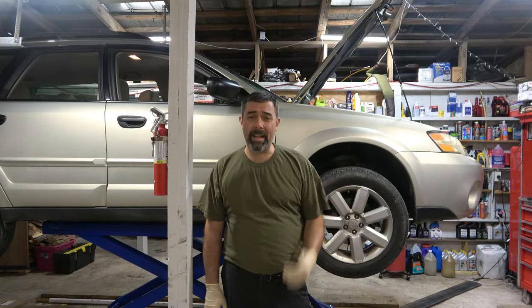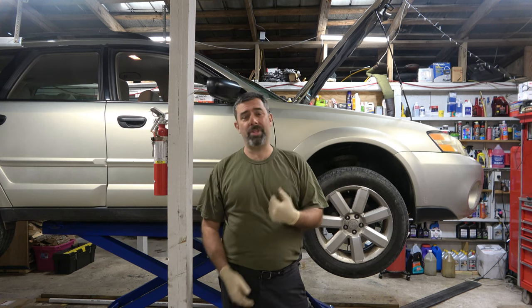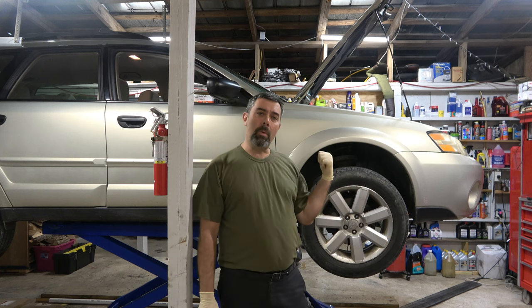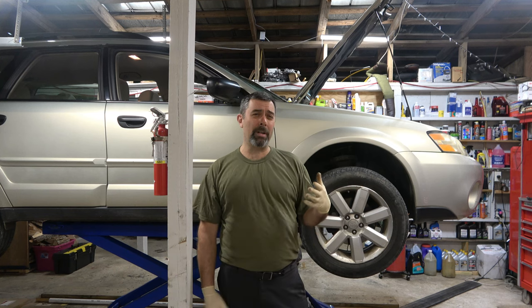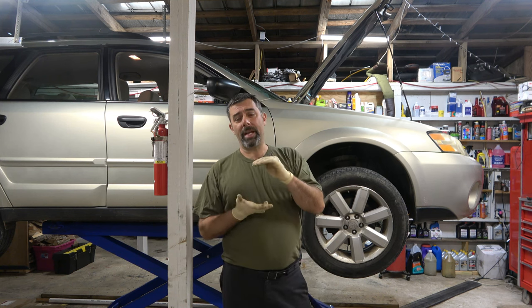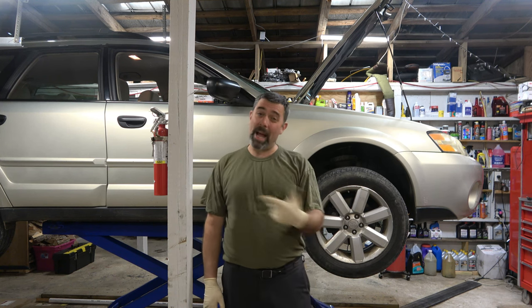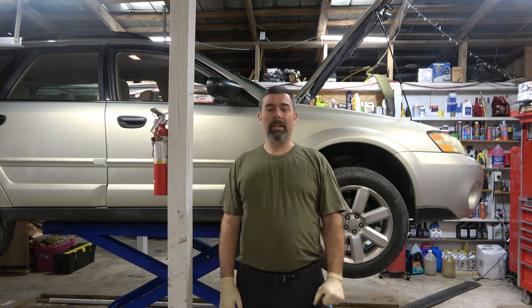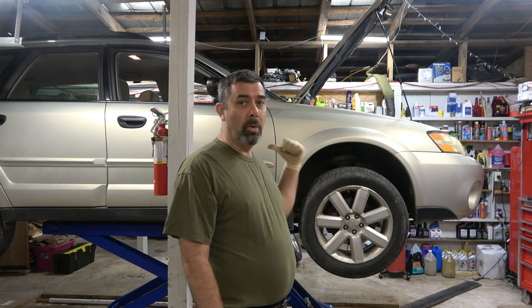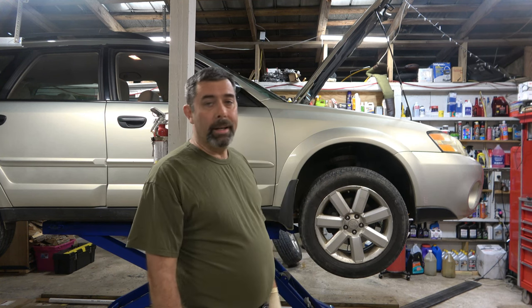I've got the car up in the air, and again you can do this with jack stands. I'm not going to use jack stands because I'm old and my back hurts. What we're going to do first is take off the fronts. The fronts look way easier to install from the instructions — we're just going to be installing the spacers. The backside is a bigger deal. The multi-link suspension needs to be dropped down and then the spacers need to be installed. If you've ever replaced struts, especially quick struts on a car, this is going to seem real familiar.